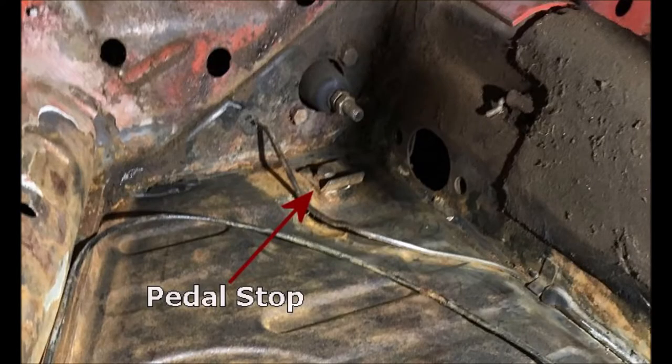I don't understand why it was like that, because that's a pretty thick piece of metal to bend. I don't get it. But maybe in a different car, I call it the bump stop on the floor, maybe it was in a different position. Could be, I really don't know. But now it's nice and even. So sometimes either the stop on the floor needs adjusted or the pedal assembly. But mine still, when I compared it to two other sets I had here, mine was definitely bent. The other two were in the same position compared to the one that I rebuilt and put in.